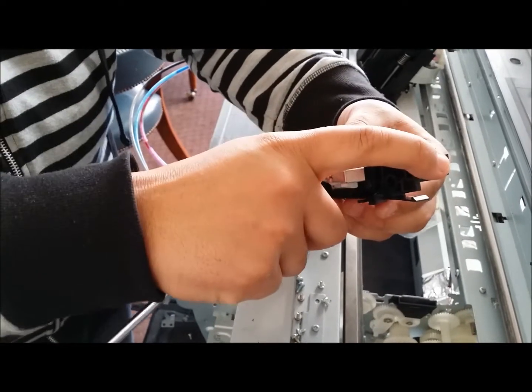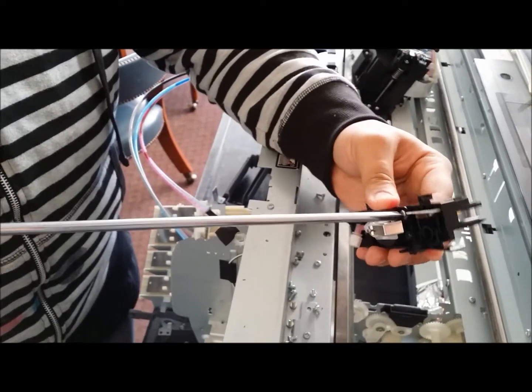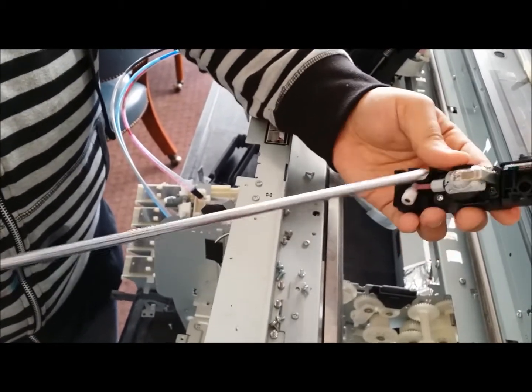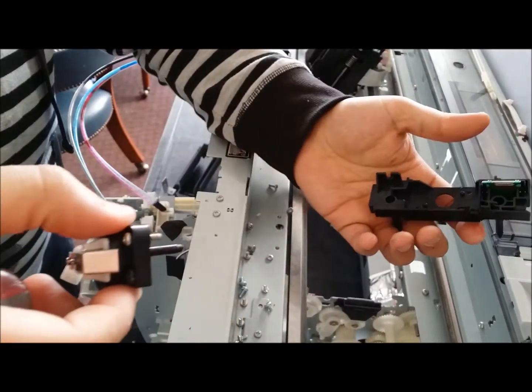So after we remove the ink bay needle slot, we're going to take the ink bay needle out, because we're going to use the housing of the new chip. We don't have to take this chip out at this point. So just the silver screws are the ones that we're going to remove, and just be real careful with the screws not to drop them out. And I'm just going to take the 2 at the bottom off, just like that.